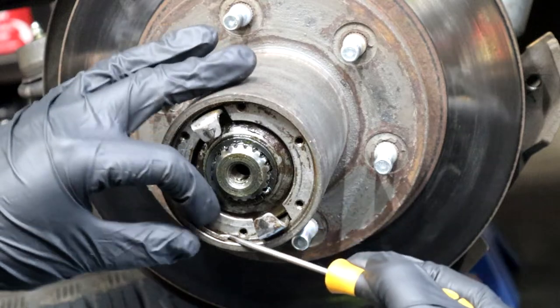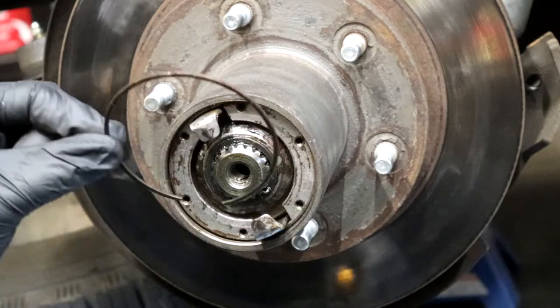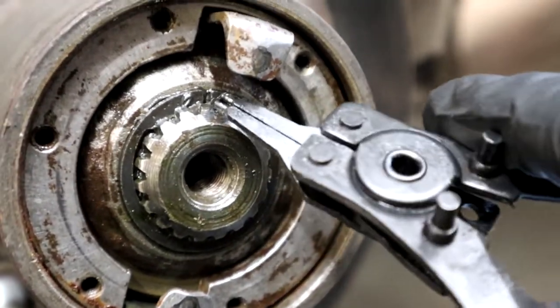Right here, after I pulled off the outer locking hubs, there's a kind of a ring that goes around the whole thing. It's not really a snap ring so you can easily pull it out with like a pick or something. After that I'm pulling out the actual snap ring which is on the inner axle shaft with some crappy snap ring pliers.